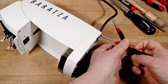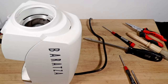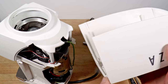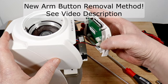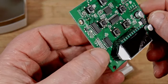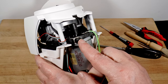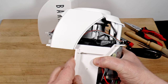The shroud comes away easily with just two sheet metal screws. The front panel comes away without a struggle and is clearly well made. The PCB is sturdy and the components are robust — this is a quality item. The motor mount is glass-reinforced plastic, which is lightweight and combines rigidity with toughness — it's great stuff and not cheap. Notice that you need only to remove the shroud to adjust the belt tension; there's now a tension adjustment screw like the Forte.